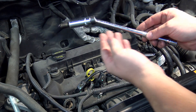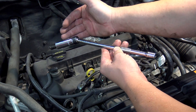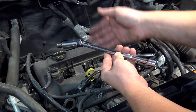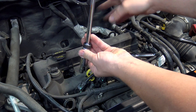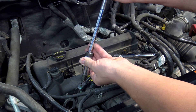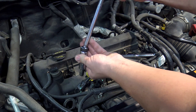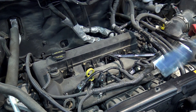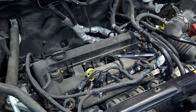When pulling the old plug out, use an extension spark plug socket with a swivel or universal joint. The reason is when you're reinstalling and you're tightening with a ratchet at an angle, if you don't have a universal you can side-load the plug and crack the porcelain. With a swivel in place, any side load just causes the joint to flex, keeping the socket in an effective position on the plug.